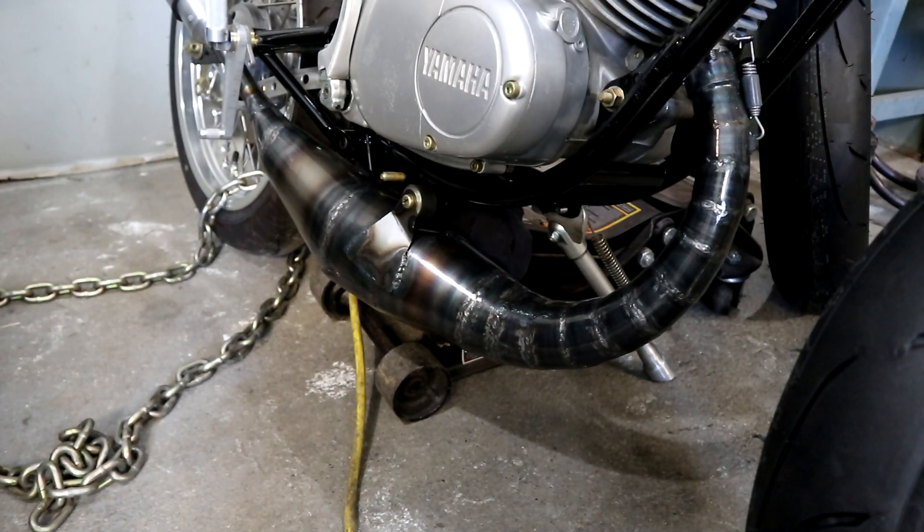Lastly, this is the RS100 pipe. It's tuned for a pretty high-revving motor, so if you're putting this on just a stock RS100 it's probably not going to perform very well. But if you wanted to make an RS, DT, or RT100 similar to the one I made, this pipe might be a good fit. I'm going to give you all the DXFs needed to get the cones cut out — however you want to do it. There will be some fitting and finishing required. There's no orientation to all the cones, so you'll still need to lay the thing out, tack it together, make sure it fits, then break it apart and weld each piece individually. But it's free, so if you want to play around with it you can.